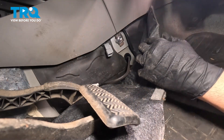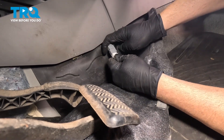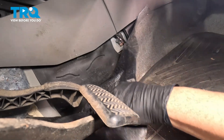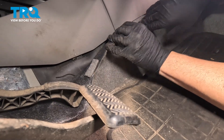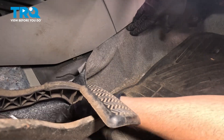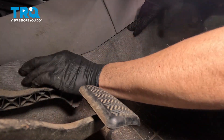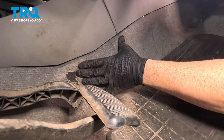Let's go wrap it up on the inside. On the inside of the car, we have our new connector. Simply line that up, push it together — you're going to feel it and hear it snap in. Just tuck that up underneath. Now we can proceed to installing our carpet. Tuck that up and under. Now that we have the carpet in place, go ahead and connect the ground terminal on your battery.